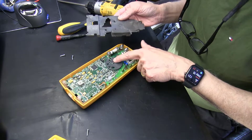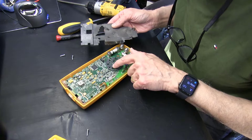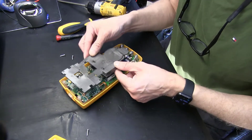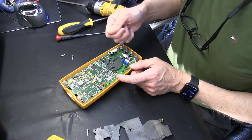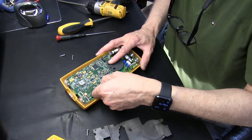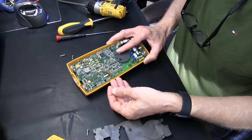You see this rotating switch? You need to make sure this matches that and it's not in the wrong position when you put it back, because if the knob is in the wrong position you could be in voltage while you're actually in current or something like that. So you have to be very careful. You just pull this one out — see how I pull this out.